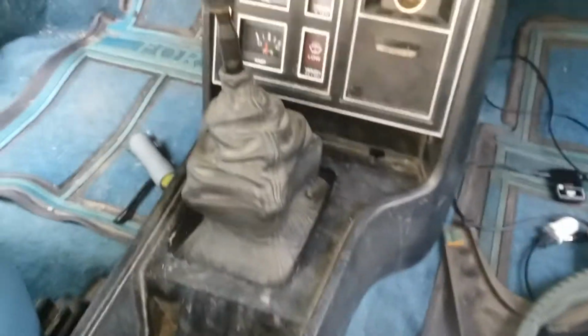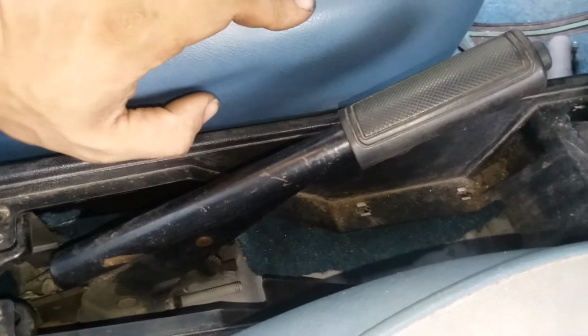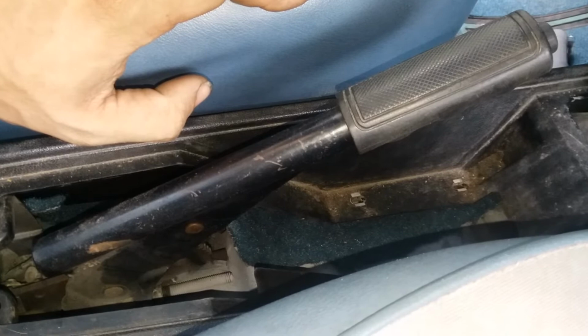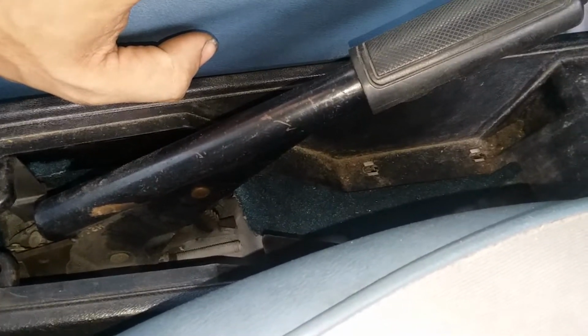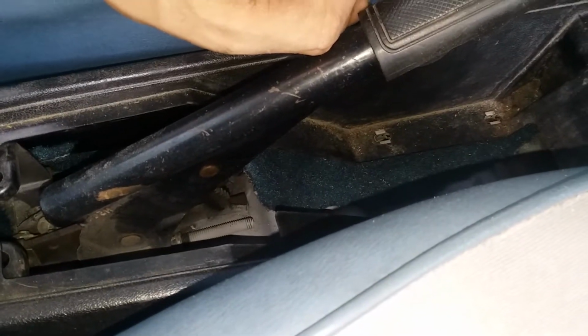Hi, so I'm in my 1982 EXP and I'm doing something that I've been meaning to do for some time now. I am adjusting my parking brake lever. I've adjusted both drums so they both catch when I need them without dragging, but when I pull the lever, my lever goes back to the topmost notch and then my brakes finally stop my back wheels from rolling.